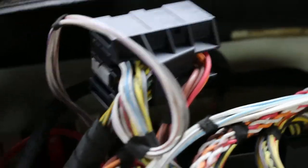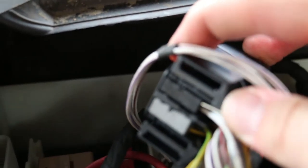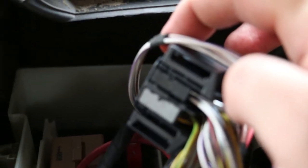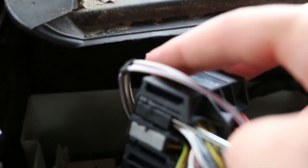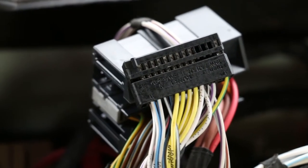Next, you're going to want to remove the top wiring harness. Put a small screwdriver or pick tool into the empty spot — there's a little tab up there. Once you've got that tab pushed open, you can use the pick tool or screwdriver to slide this whole assembly out.